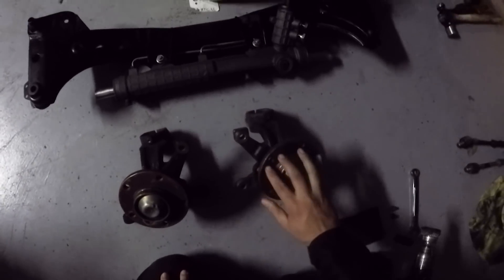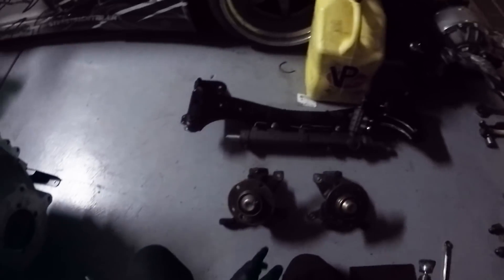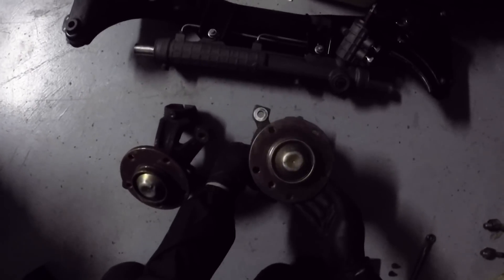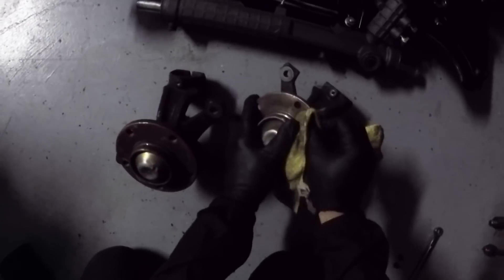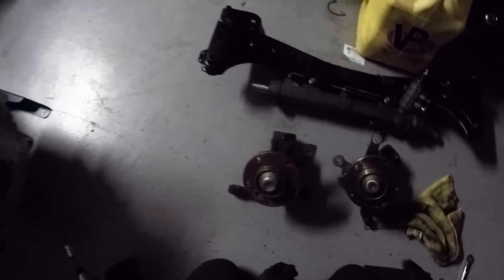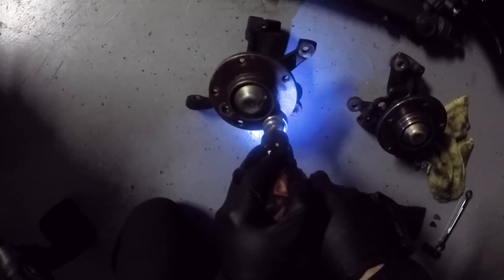The surface here on the hub is where the rotor actually sits against, and you don't want any kind of residue buildup, rust, paint, or anything between that. It'll naturally get rusty — this one is still rusty — but I'm hitting it with a wire brush and taking the rust off. You want to try to get rid of the rust so nothing sits in between. You want it flat and perfect with no corrosion. Same thing on the hats on your rotors where your wheel actually meets up.